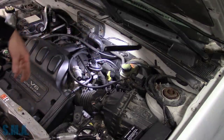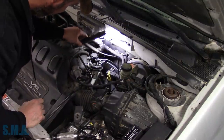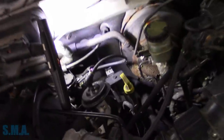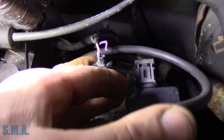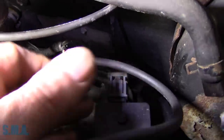Oh, never mind, we just fixed it. The problem is on the control side. And the problem is nobody tugged on the wires at the back of the connector. Let me show you. This is easy. And they were so close with their parts cannon too. I just give a little tug on the back of the harness and the wire broke in the connector.